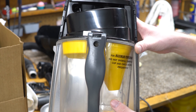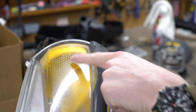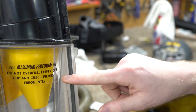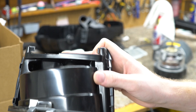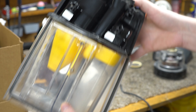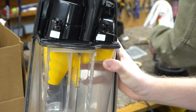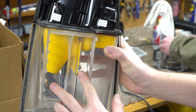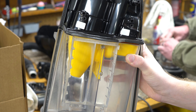The cyclone is actually very primitive and was later replaced. The cyclone is dual chamber, similar to a Hoover, but instead of using just a screen, you can see there's a cyclone here, and the other top part of that cyclone is right there. This did not work very well — this whole thing would get very dirty. On the back, there's a space for a filter, and this filter would get almost instantly dirty. They would tell people to change it every three months, which was very optimistic — it was more like every three uses.